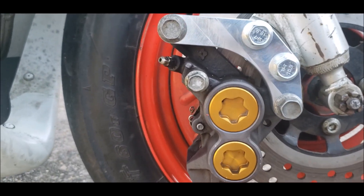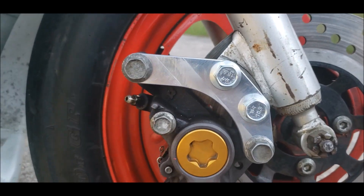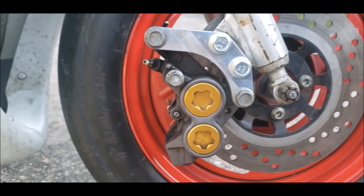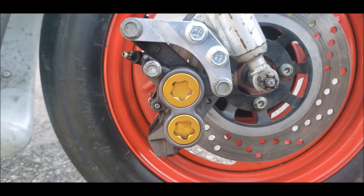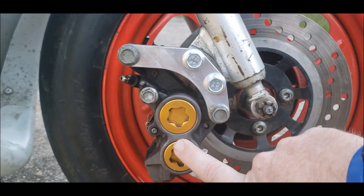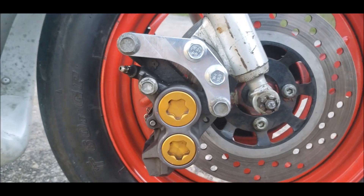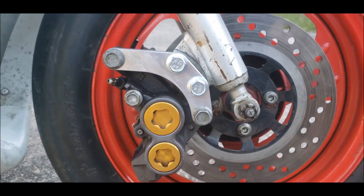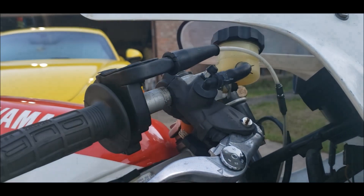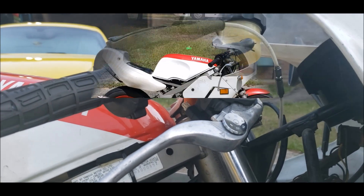You can see the custom bracket that I've made, and obviously these were never designed to go together. So I should have all the braking power that I could ever need or want. It's really overkill and I'm aware of that, but this was 25 bucks to the door — well, it was 30 to rebuild the stock caliper. And I really wanted a Brembo, but I can't justify a Brembo for a YSR — it makes 10 horsepower for now.